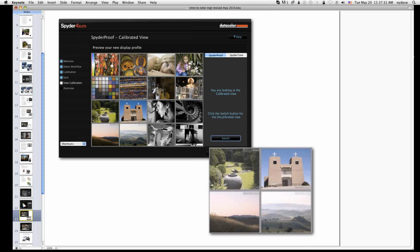You know, lately I've been getting questions via our technical support group about age of monitors, and I'm seeing people who are trying to calibrate monitors that are 5, 6, 7 years old. And I want to mention that if you have a display that's older than 3 years old, you really want to start taking a hard look at its performance, because over time, even flat screen displays do wear out, and they become less and less flexible in terms of calibration. And so you'll start to see flaws like a tint in the black and white areas, or you'll start to see certain colors start to shift.